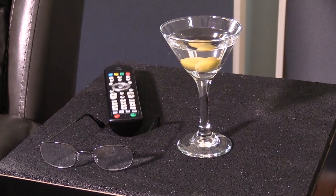Never go back — because once you hear the difference, you never go back. And the wife likes it too because she can put her martini glasses on it. So we win with the WAF factor also. But one subwoofer in a room is usually enough. I don't see any rooms lately with room forms that can handle multiple subs. Stay away from putting them in corners. Stay away from the multiple sub idea of smoothing out frequency response, because subwoofers at $1,000 to $2,000 a pop — you need four of them to really have a six or seven dB impact on low frequency response, and it's still not as clean as one subwoofer positioned correctly.